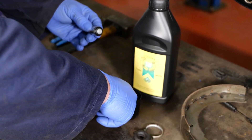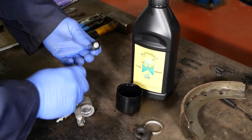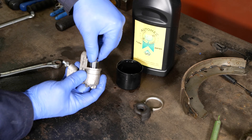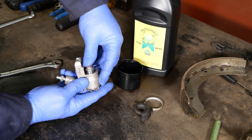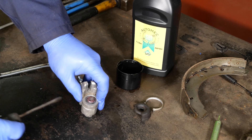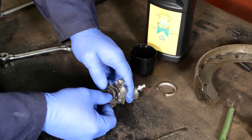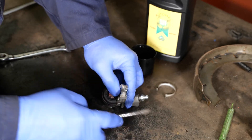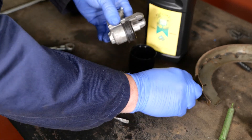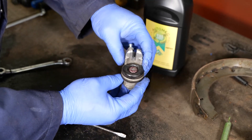So we're going to lubricate it with some special brake fluid. Gently insert it back in the cylinder — you'll know when it's seated, it only needs a bit of gentle persuasion. Down it goes. The dust seal is in perfect condition, no splits or tears, so we're going to refit that back over. And that's it — one wheel cylinder fully rebuilt.